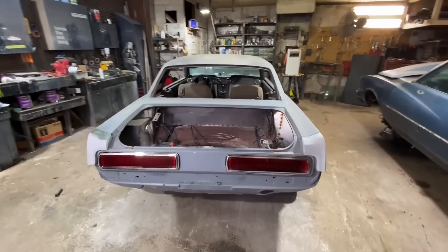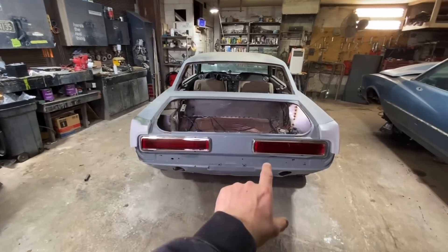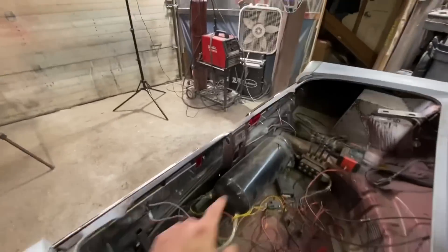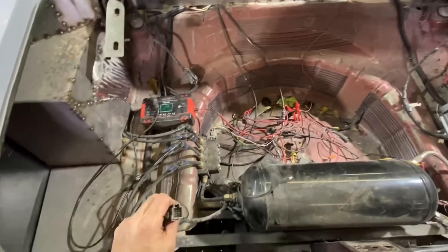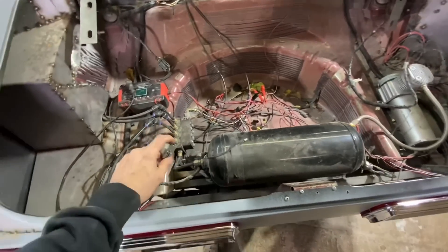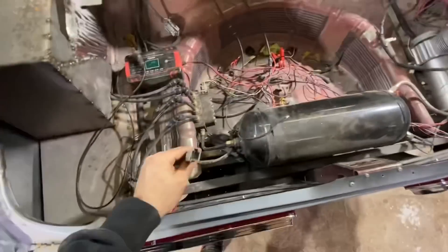I absolutely love those taillights - they are so expensive. I had to make the housings for four hours, took forever, but it is just worth all the hassle. I love how they look. I got plenty of adjustment and the backing plates came out fine. I did have to cut my braces - I'm gonna end up rewelding those here in a little bit. But it is time to wire up the lights. I have no clue what plug-in is what - I have several plug-ins. I think it's this one for the passenger side and this one for the driver side but I'm not sure. I'm gonna get the test light out and start doing some checking. If I was smart I would have kept the plug-ins to the old taillights - I actually thought I did, but over the four or five months we've been building this thing I apparently threw them away.